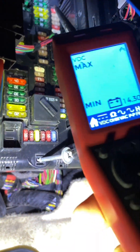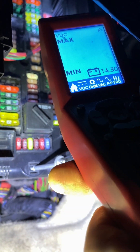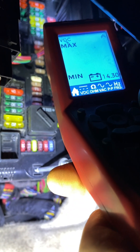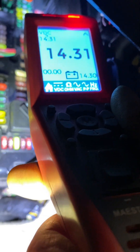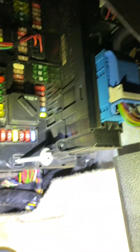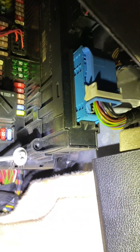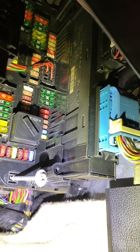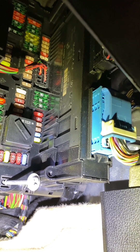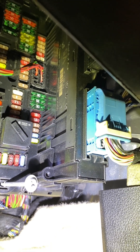Let's try that again, guys and girls. There's a few girls watching my channel, a few women as well — we need more women in this game. Women make better fault finders than men. 14 volts in, not a bloody sausage out, because BMW designed this marvelous system so that if the fuse goes for the handles, all your bloody car shuts down, literally. Let's change that fuse — if it's a dead short it'll pop, and then I have to take every handle off one by one to see which one is causing the short, because they're all connected. Another brilliant idea.